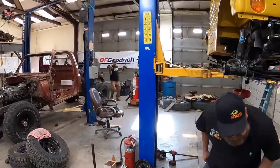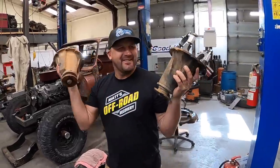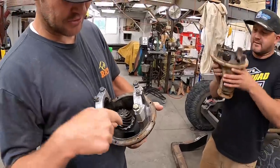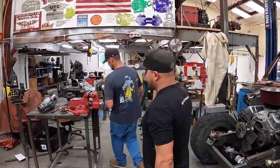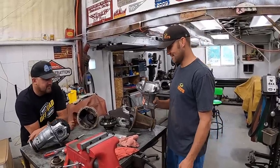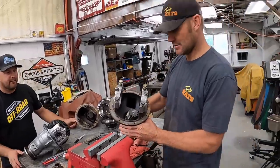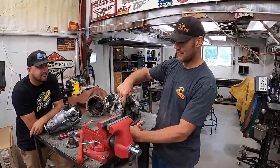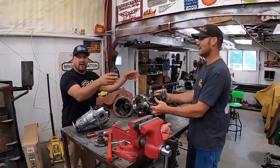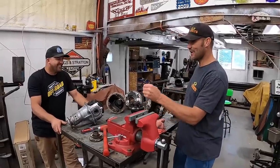You're the guy we've been waiting for — Samurai parts. The man, the myth, the legend. They're like little go-kart differentials. So I was telling you guys about the oil path — see that hole in that, and that one up there? That shoots oil directly to the front bearing. I should have realized that when I put this in. There is no oil path to the front on the Tracker unit. I'm sure the sandblast media didn't help it, but not getting oil didn't help it either. So we'll take this one, clean it up — it's got those oil paths to the front. The ring gear is in here flipping oil, spitting it straight down right to that front bearing. This will solve our problems. How you make them last longer is you've got to get a lot of mud and water in there and then they'll last for 20 years. We only got about 12 miles out of these ones.